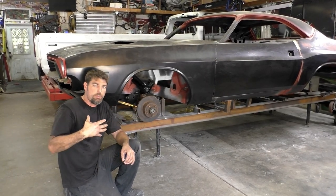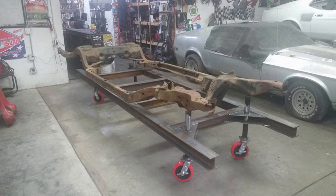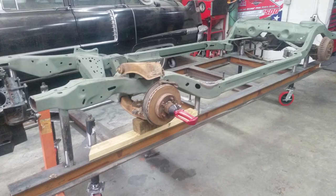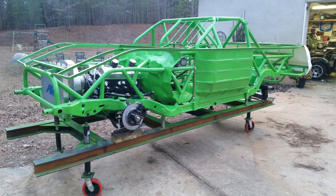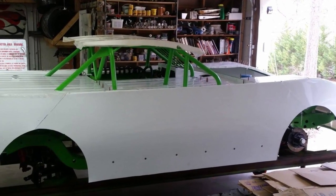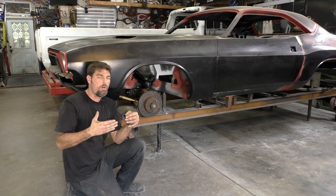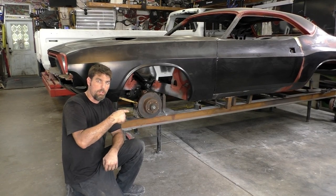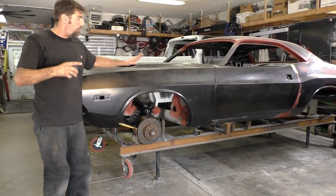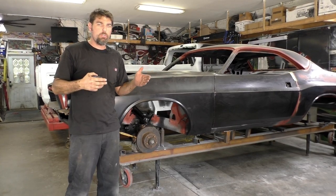What introduced me to frame jigs was actually through race cars. We get a race car, put a chassis on the jig, get the chassis level, then come back through and bend and tweak the chassis in certain areas for certain drive characteristics. The frame jig for me was a controlled way to set a crooked car basically to give us an advantage while going around one circle. Knowing how much of an advantage it is, if we move the car half an inch here or there on a frame jig, you can imagine - when you're building and restoring these cars, you don't want to be a quarter inch or half an inch off on heights, wheelbase, or anything else. It could lead to a really ill-driving car.